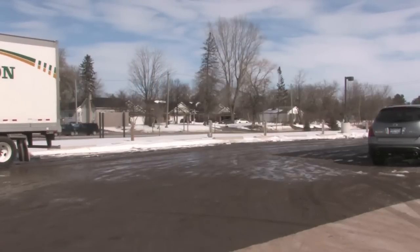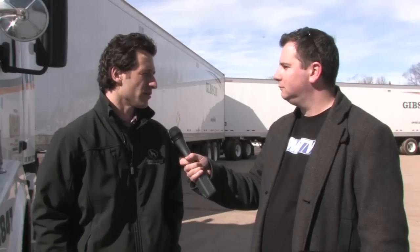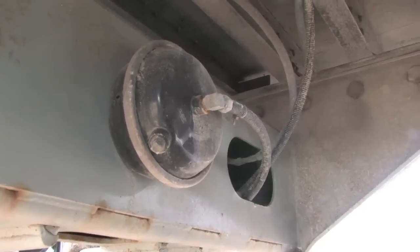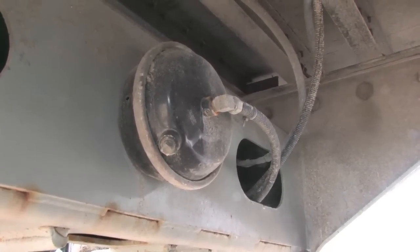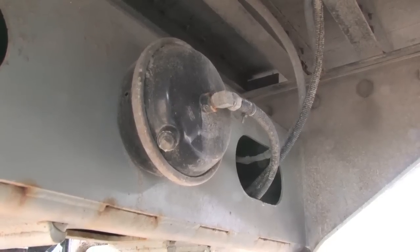Assuming I do want to purchase some new trailers for my LCV fleet, what are some of the speccing considerations to keep in mind? Is it just like speccing any other 53-foot van, or are there other considerations? Well, the first thing is the pintle hook design. The requirements of the LCV program state that you have an air snubber on your pintle hook, and that basically keeps constant pressure on the pintle hitch so that the converter dolly is well-connected to the pintle hook.